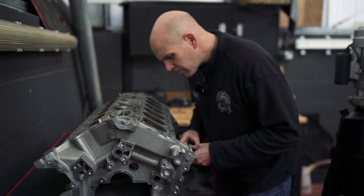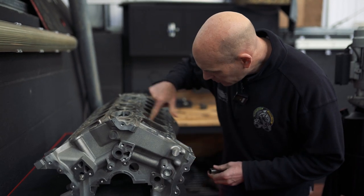This is an old block that's been on the shelf for a while — it has a little corrosion on the liners — but it was removed from a car making exactly the same sound we just heard. It's a combination of two things; we've never found engines exhibiting this sound to have just one of these faults. That makes the repair more difficult, because if it were just the small end bush it would be a simpler rebuild — you wouldn't need to machine out all the liners and rebuild with new liners and new pistons, which is extremely expensive.